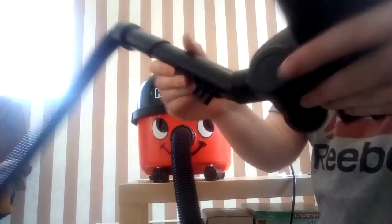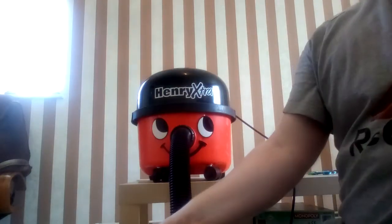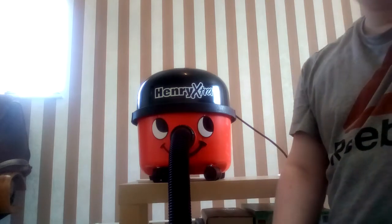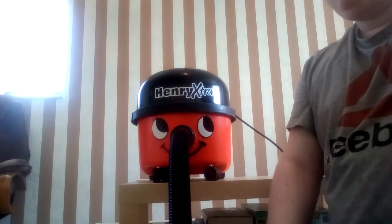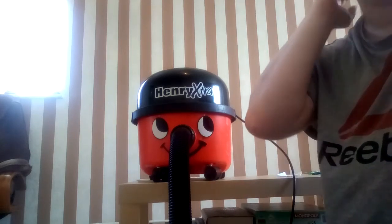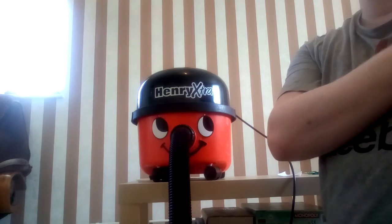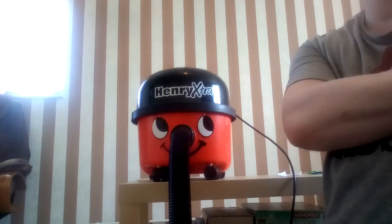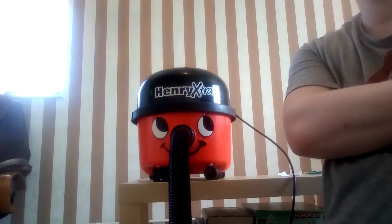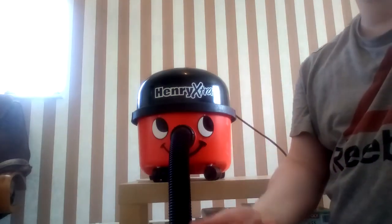So you could see that when the machine's on, the suction goes through the brush. It propels the fan, which in turn drives the brush roll. Now, it's a little secret for you. That Airo brush, in case this puts you off buying one of these, it's actually not that noisy on carpet. Especially if you've got a thicker pile of carpet, like I think I've got in my hallway and my bedroom. It's pretty quiet. You can still hear it, obviously, but it's very quiet. But if it's on hard floor, you'll hear it a bit more because there's more room for air to go in, and it's spinning that little bit faster.